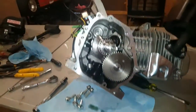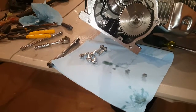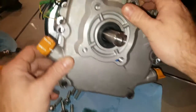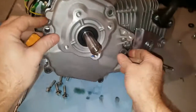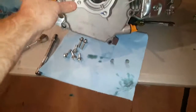Now that everything's removed — the black washer out, double and triple checked — I'm going to leave the low oil sensor in place. The small extra oil volume gain isn't that important, and it's sealed, so why mess with it. I've cleaned the gasket surfaces and we're ready to put the side cover back on. Putting it back on is simple — just make sure you get the bearing lined up and then the bolt holes lined up, and it should go back on fairly easily. If yours doesn't, you might have something out of line, but it should snap on just that easily.